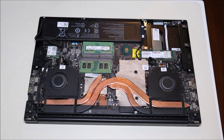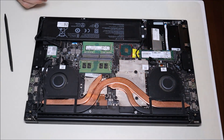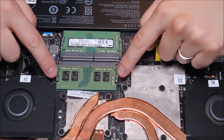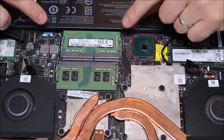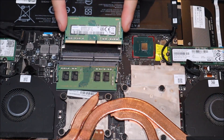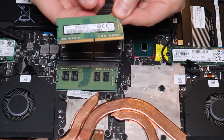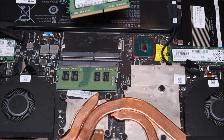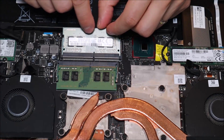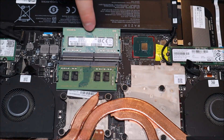After unplugging your battery, we can go after the other components. These are your RAM sticks here, held in a very typical way for a laptop — by two metal arms on each side. To get them out, gently pull those arms apart and the RAM stick pops up, then just slide it out. There's a long port and a short port, so your RAM can only go in the correct way. To reinstall, put it in flush, press down, snap it in place, and those arms will click and it'll be secure.